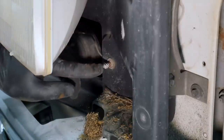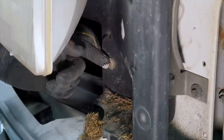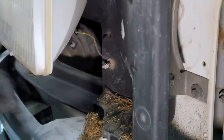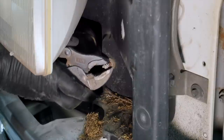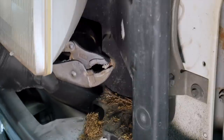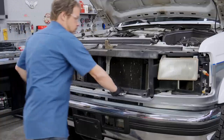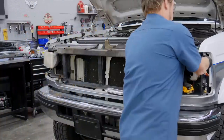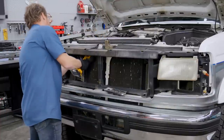This stud is actually molded into the back side of the headlight bezel itself and they turn out of there. Sometimes the plastic gets brittle and breaks, so we're just going to hold it from the front side with a vice grip and back off the 11 millimeter nut — we'll glue it back into the bezel or we'll get a new one. The grill reinforcement panel is held in place with eight millimeter bolts that we're going to bag and label just to keep track of them.